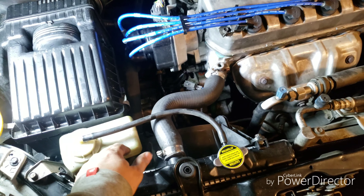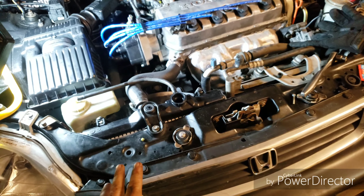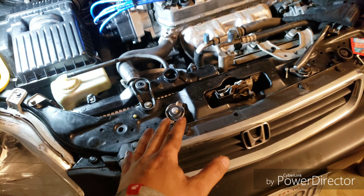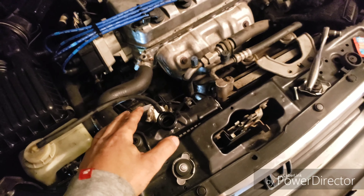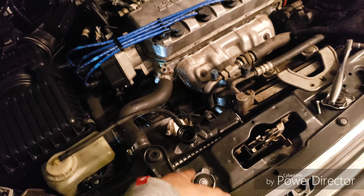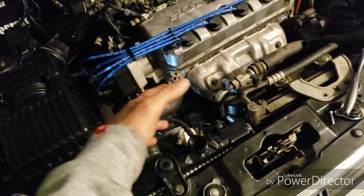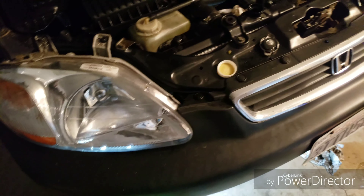Toss the air filter back in - let's try to get it in one shot. Boom! So this got kind of messy from the spill so I'm just going to clean that off. Now let's add the last couple things - put the cap back on, angle it in, and the hose attaches to the radiator. The reservoir still had coolant inside all the way to the full line, so all we've got to do is fill up from here. I'm going to start the car while it's still lifted to make sure it's not leaking from any of the lines - that's why I haven't bolted on the splash guard at the bottom yet.